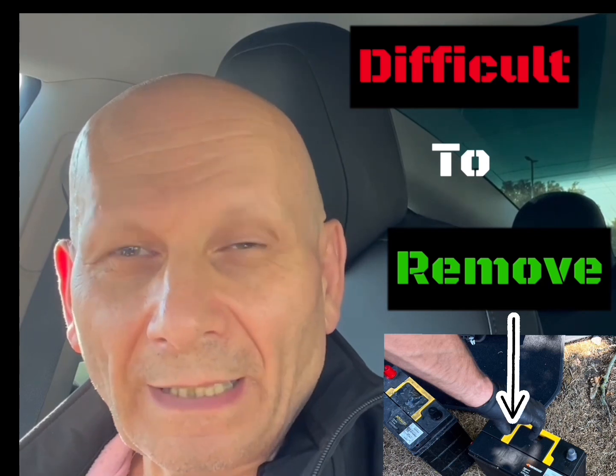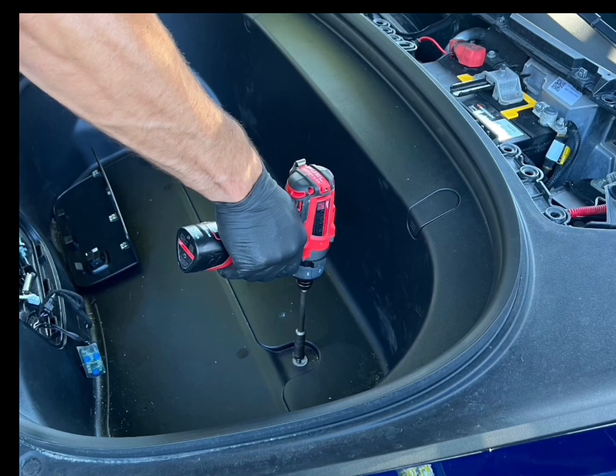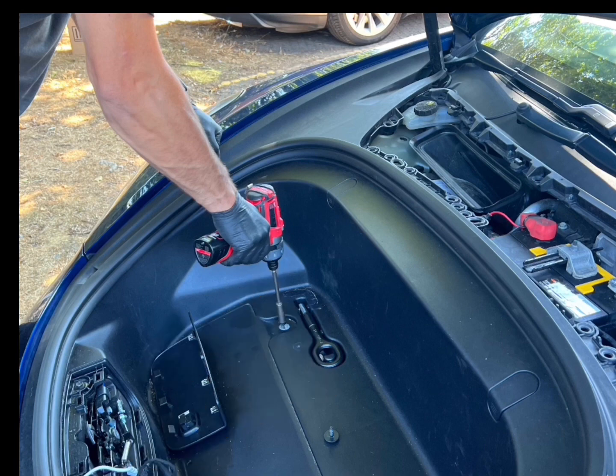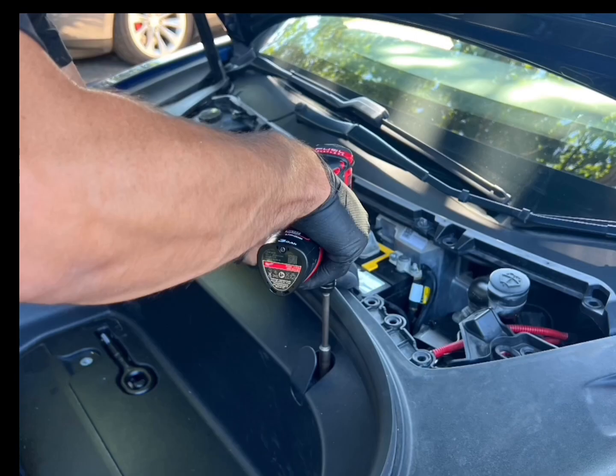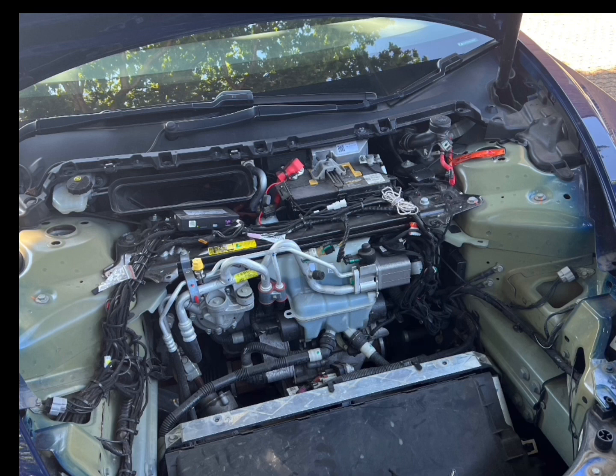Once you've got the actual power plug out, the car is safe — the 400 volts is no longer being fed to the car, which means you can touch those terminals without worrying about a shock. To take the battery off, it's very simple — a couple of screws — but you have to take a little tub off first because you can't get it out without removing that. It's only seven screws. Unclip the cover on top, take off the bottom clips, and that's done — remove it.